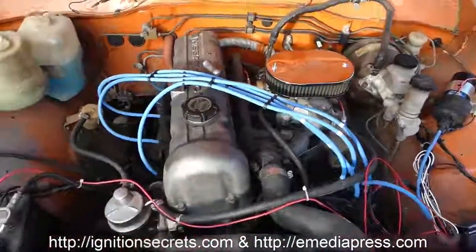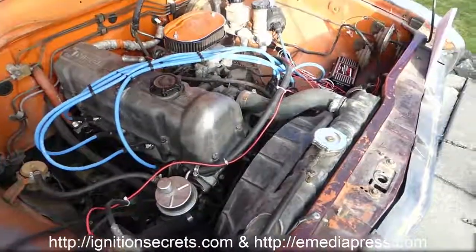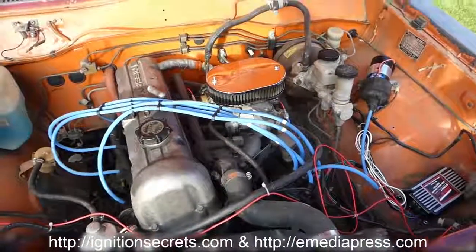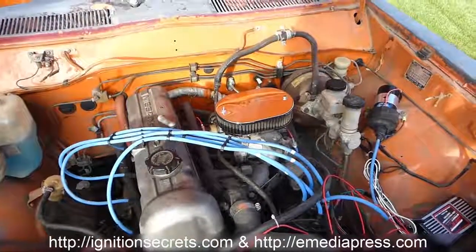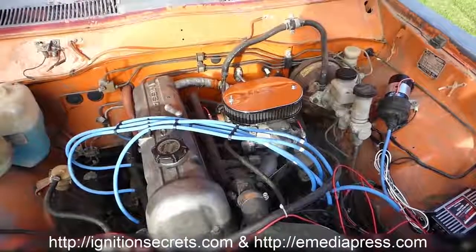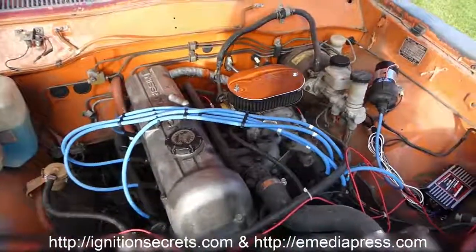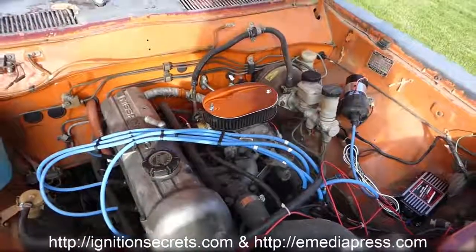And so when people are adding hydrogen cells, basically commonly ducted water electrolysis cells, as a fuel supplement, the gain is not coming from the hydrogen exploding and pushing on the piston. There's not enough to do that. What that water gas supplementation does is that hydrogen is very fast and very hot, and it ignites from the water fuel cell, and it flames really fast, detonating into the rest of the combustion chamber, and it more thoroughly ignites the rest of the fuel that's there that a normal spark can't.